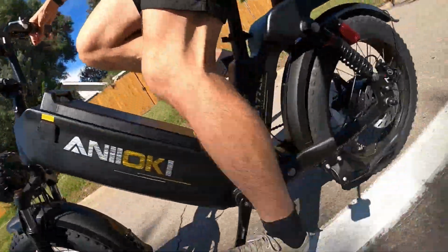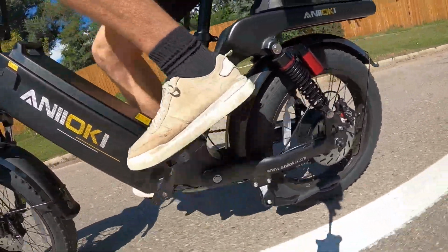The pedal assist sensor on this bike is a cadence sensor, which means it measures revolutions of your pedals going around, and the effect of that is that there's a delay. So when you start pedaling, there's a little bit of a delay before the engine will kick in, and when you stop pedaling, there will likewise be a delay before the motor stops. But it's not that much of a delay, honestly, and it feels pretty smooth when you're already in motion. When you start pedaling, it'll just kind of slowly ramp in to meet you. They've got it pretty well dialed in. It feels good. Even though it's not quite as responsive as torque-based systems, for a bike like this, I don't think that really matters. I think it's a pretty good fit on this sort of moped style.